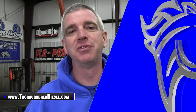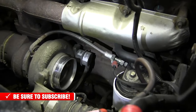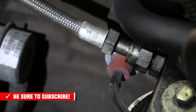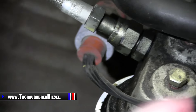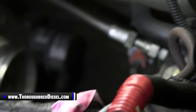The important part of this video — we're actually going to show you where the block heater is. On both the 5.9 and the 6.7 Cummins, the block heater is directly behind the oil filter. Adam's going to zoom directly in on that. It's just got a little silver cap right underneath that oil line, and it's got a little silver screw that holds it down. So we'll unscrew it real quick and get this one switched out.